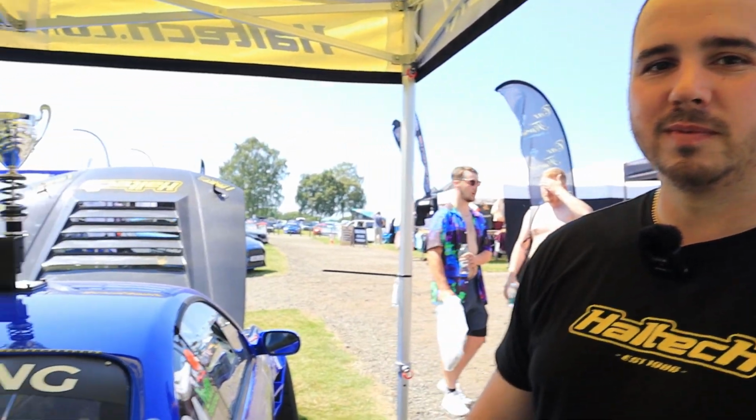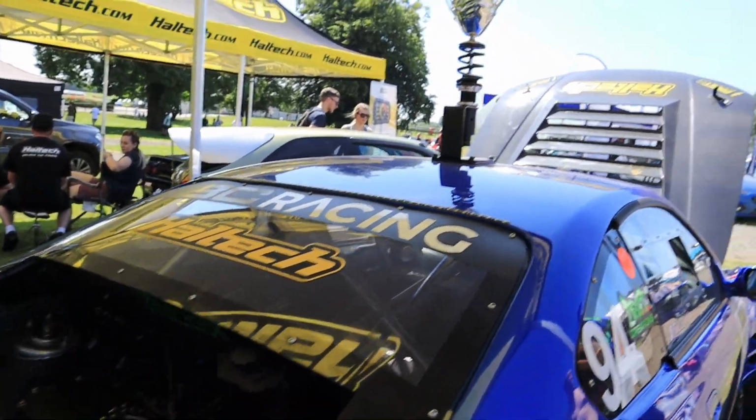And you're using GTR drive shafts to match it? Yeah, GTR drive shaft, yeah. Yeah, it's an easy swap on the Silvias. It's literally bolt on. You bolt the diff in, it goes in the exact same position. The only difference is the hubs. You just have to change the bearing carrier, and that's it. And they're on, effectively. So it works really well. Great. Works really well. So let's go inside. Yeah.